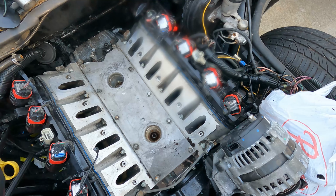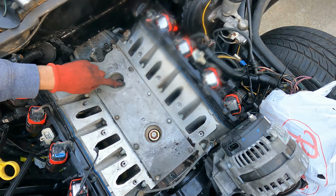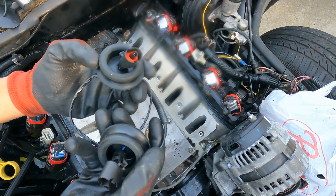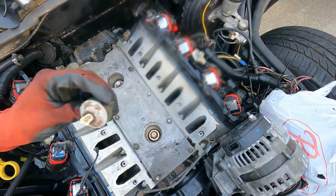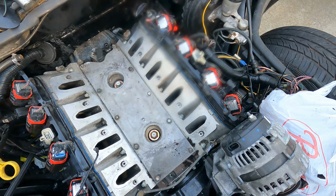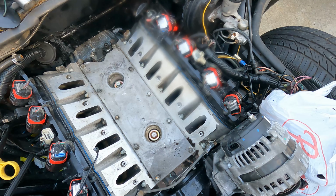So here are the new parts. Go ahead and throw that bad boy in. And here we have the new harness. I've been told that it's good to put silicone or RTV around the outer edges of this, just to make sure that no water enters. The effects of water entering look like that. You see how it's all corroded, rusted. You got stuff flaking off and falling. The plastic is brittle. So to prevent that, we're gonna put some RTV around these black rubber boots.